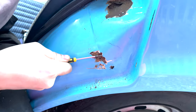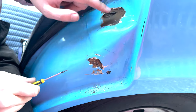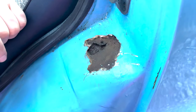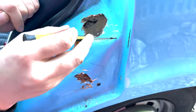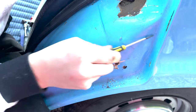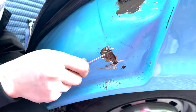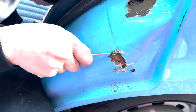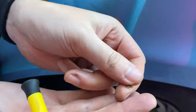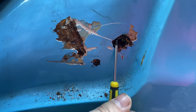You can identify filler because it's so bloody chunky. I did expect there to be a bit of this on this car. But if you look at this area here — yeah, it's got the chicken wire — but if I just attack it, we're solid. It's just this top piece here. Get that cut out, get a new one shaped and welded in. We're just digging at this bit now, discovering a bit more crap. No holes yet — well, there's a tiny pinhole here, I think. We'll keep getting this off. So we can see we're pulling out bits of chicken wire now, and this bit of metal here has just completely gone to reveal... the freaking chicken coop.